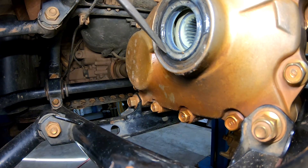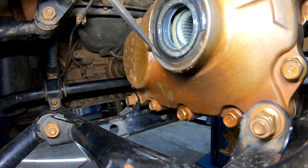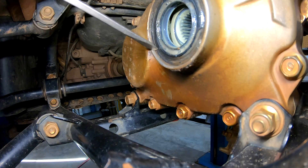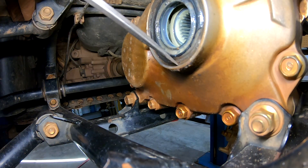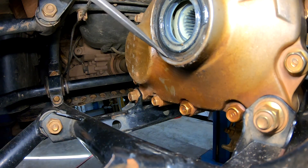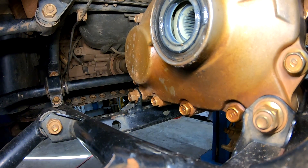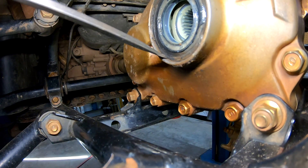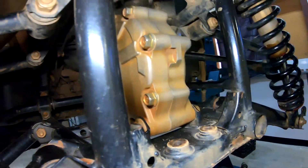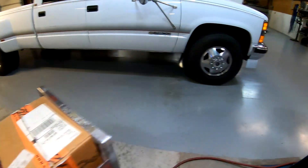See right here how deep that seal is sitting? There's the outside edge. How deep is that seal sitting — and it could be a shoulder in there. So you drive it in until it hits the shoulder, or there might not be one — I don't know yet. I'm paying attention about how far the depth is where that's sitting, which looks to be not quite an eighth of an inch. So I'm going to pop these out on both sides. You can see the other side wasn't leaking as bad.